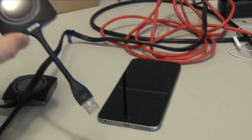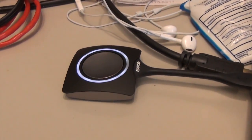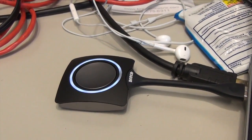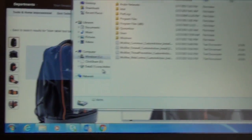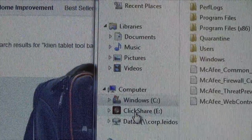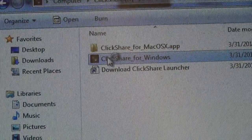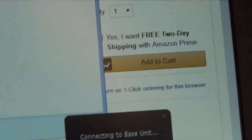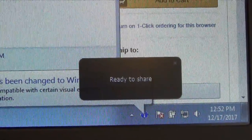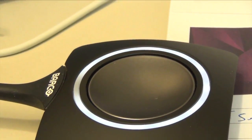Here is our Barco dongle — I'm just going to plug it into a USB port on my laptop and wait about 30 seconds. You can see it is flashing right now. Now I'm going to go to my file explorer and open this up. If you had a Mac you could go that way, but I have Windows, so I'll just double-click on this. This runs a temporary application on your computer, so you do not need any administrative privileges because you're not installing anything. And right now it says you are ready to share. You can see the dongle is no longer flashing — it is a solid white light.